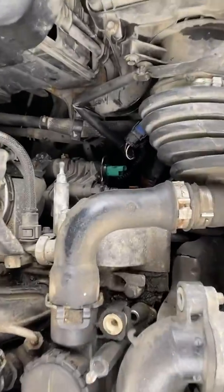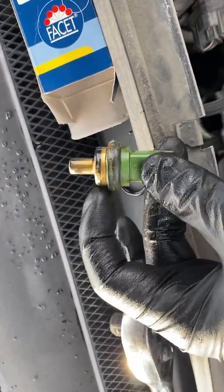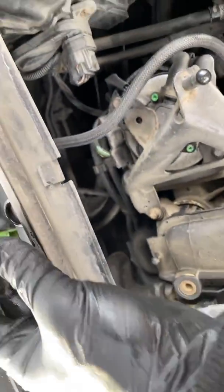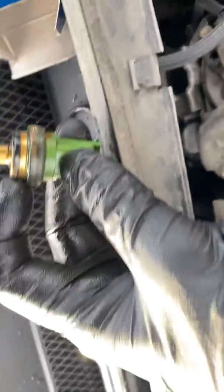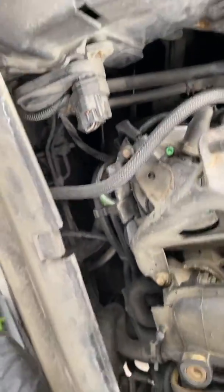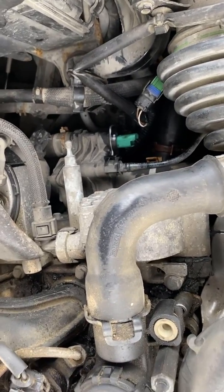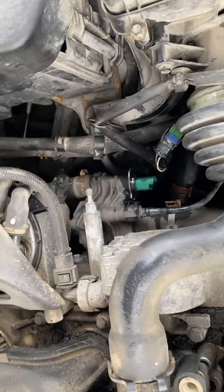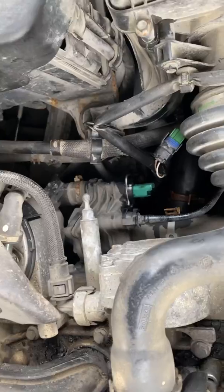Okie dokie, we're back. I made the mistake that when I pulled out the original sensor there was no seal on it, which seemed odd. I proceeded to fit the new sensor with its seal and it wouldn't go in flush. When I pulled the new one back out and felt inside the housing, there were two seals in there — the original o-ring had stayed inside — which is why it wouldn't fit.